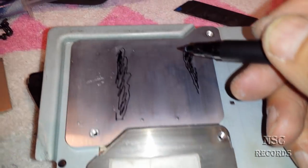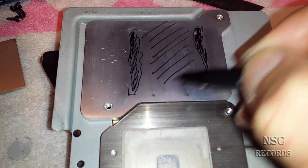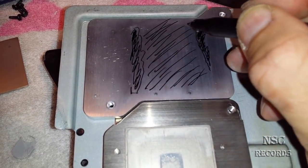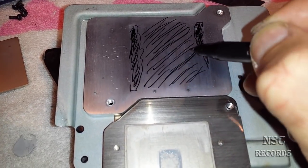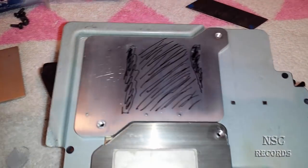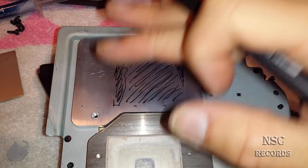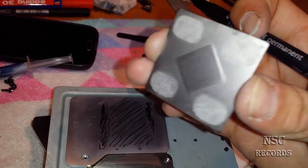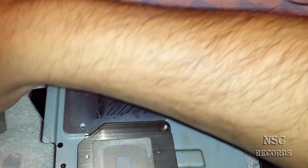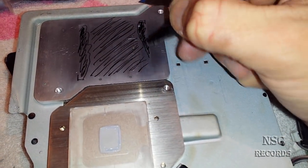The bigger problem now is that this middle area has no cooling. That means the heat spreader has no contact to the cooler here — there's a lot of air because the CPU is touching the heat spreader on the sides, but the heat spreader is not touching the cooler in the middle. That's a big problem. What you need to do is lap this area with sandpaper — this place needs to be lapped, and this place here needs to be lapped a lot.